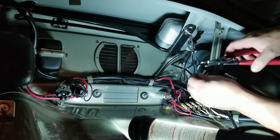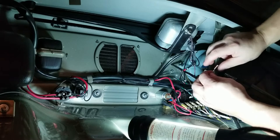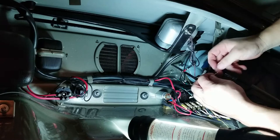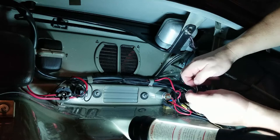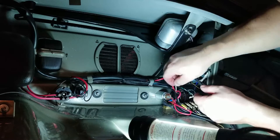I don't like a lot of extra wire flying around, guys. If you haven't figured it out, this is pretty thin stuff. I'd say this is probably like 22 gauge wire. So I'm doing my fold over method, which I usually just take the copper if it's super thin and then fold it over to give me a little bit of extra. All right, come on, we'll feed you down in there. Be nice. There we go. That's what I'm talking about right there.